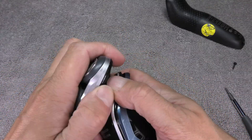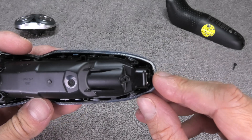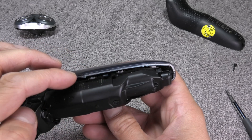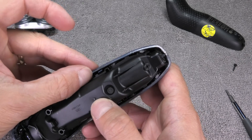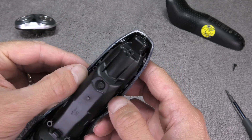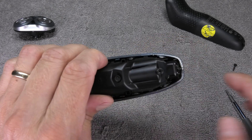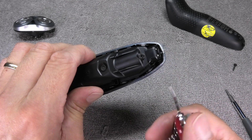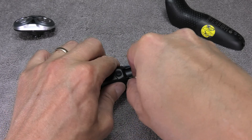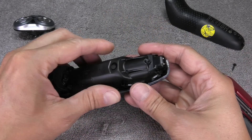Once that is done and we remove the shave head, we can start to remove the front cover. There are a whole lot of plastic clips all over the place, but the only two we're really interested in are the two blue ones located here — one on each opposite side of the main housing. When we have those unhooked, we still can't remove the waterproof housing in the center quite yet. But if you use a small screwdriver and wedge it in at the bottom end where the charging port is, you can pry it loose.